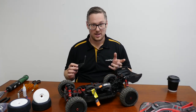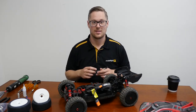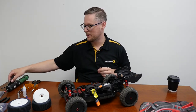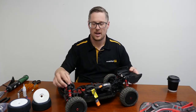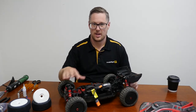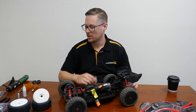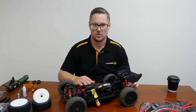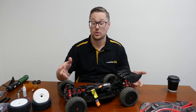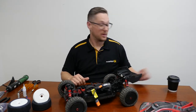With all that being said, stay tuned and watch along. I'm going to do some work and make this accelerated. We might stop at intervals to talk about some stuff. But before I get started, while we're doing these upgrades and after our first shakedown run, it's a great time to go through the car and check screws. Take a two mil or two-and-a-half mil driver — it'll do most of the screws in this car. Check they're all tight. It's a good thing to do on a new car after your first run or two.